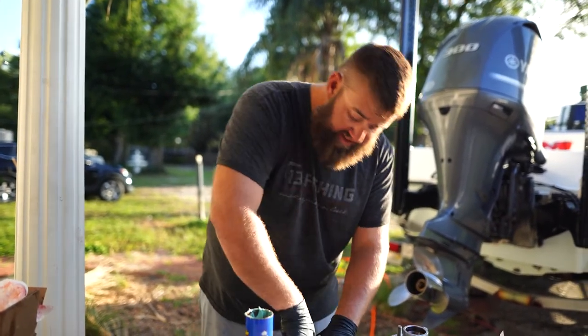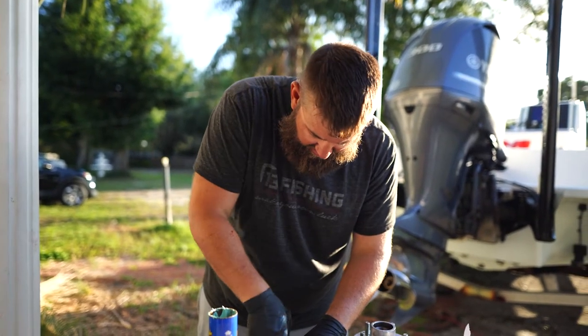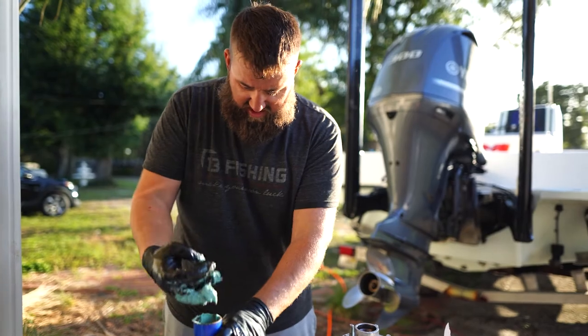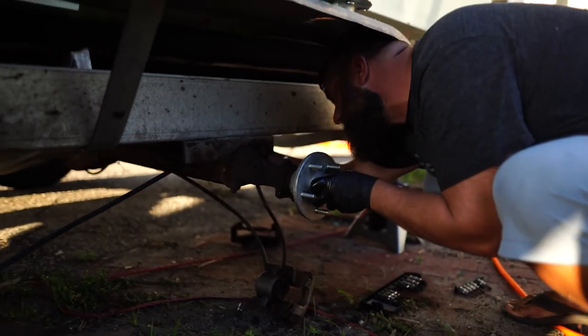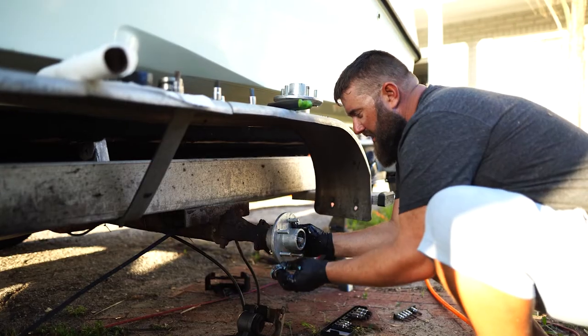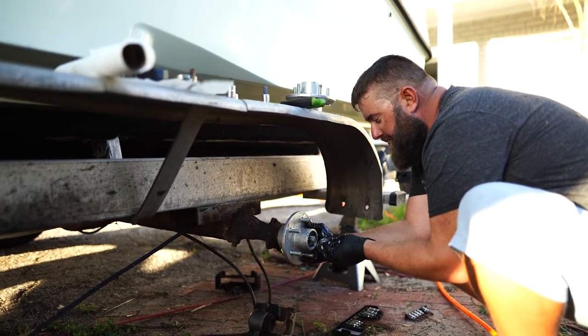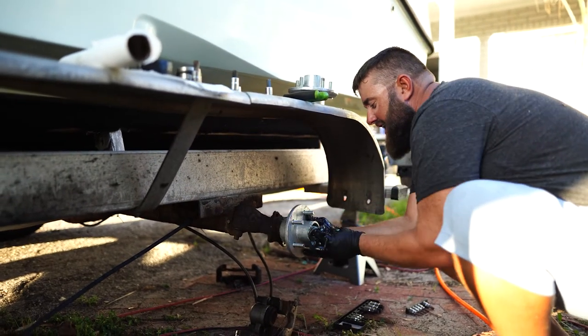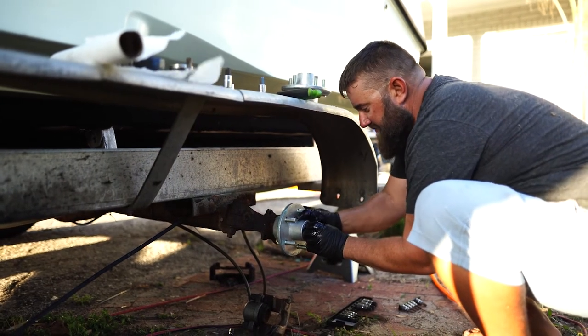Keep in mind you actually can put too much grease in here — if you put too much, you'll blow the rear seal. Now we're going to slide the hub on and see how that rear seal sits. You want it to sit all the way up against there. It looks like it fits pretty good — you can tell it's the right rear seal because it'll sit in there real nice, especially once you get the front bearing in, and when you spin it, it'll feel real tight.